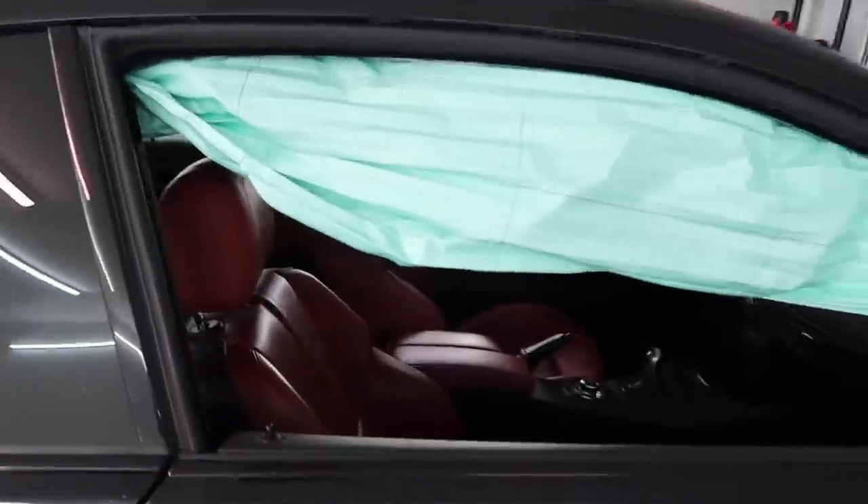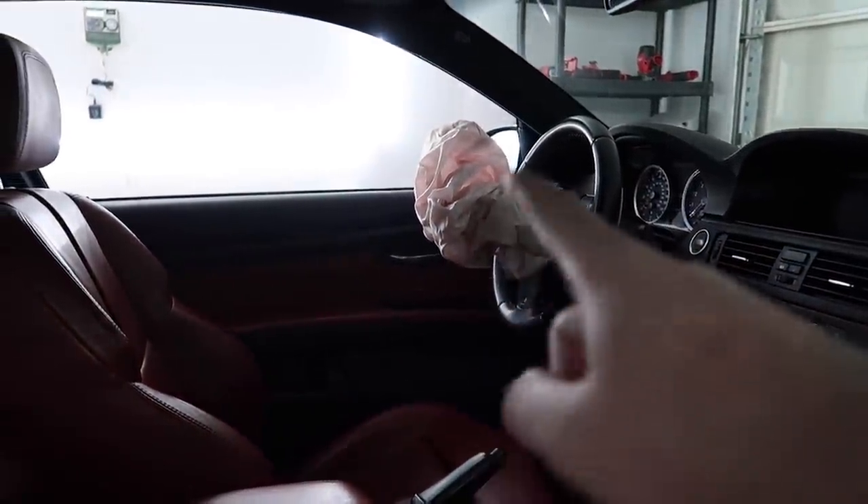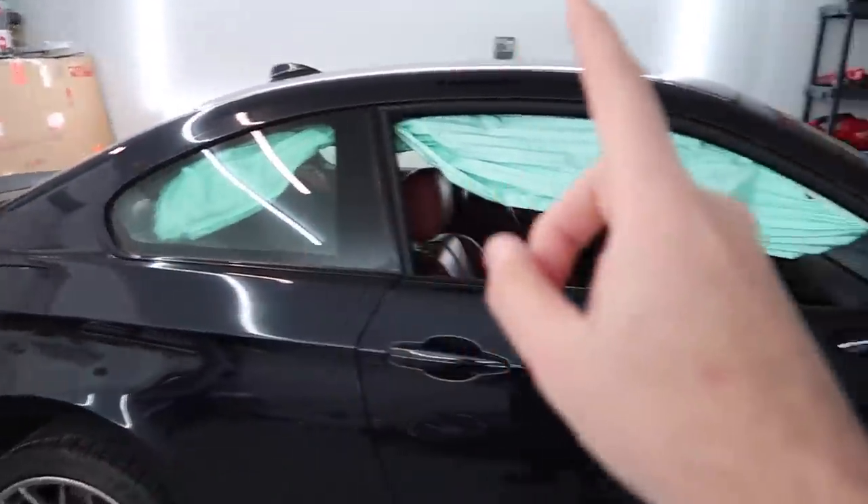We're on the road to perfection and I really want this thing to be perfect. So first things first, let's go ahead and replace that airbag because that's quick and easy — it'll give us more space. That airbag is taking a lot of space on the driver's side. Then we need to remove this and remove the headliner. I'm probably going to take it down to L&D Solutions since I can't find an M-Sport or E92 headliner anywhere locally — all the E92s I found happen to be the ones without the sunroof. So I'm probably going to get this headliner rebuilt at L&D Solutions. Let's get that headliner off, get that airbag out, replace everything, and possibly clear the airbag light.